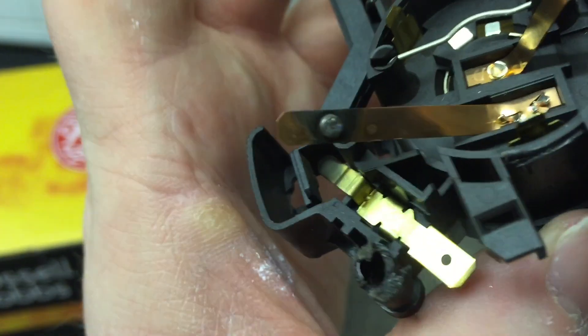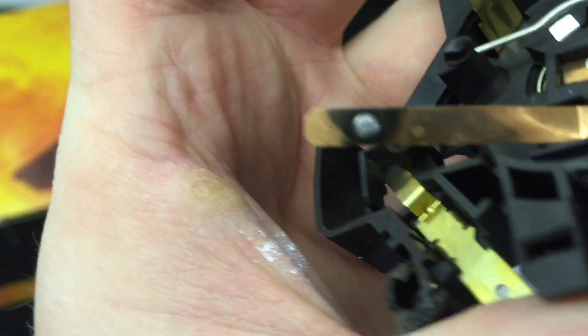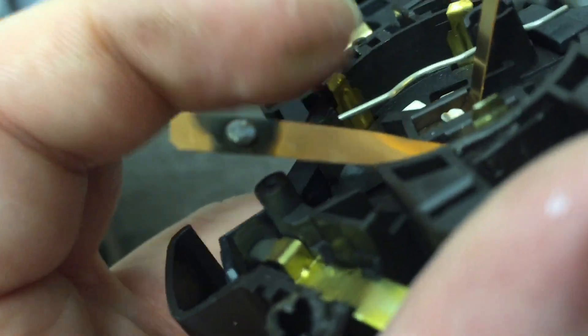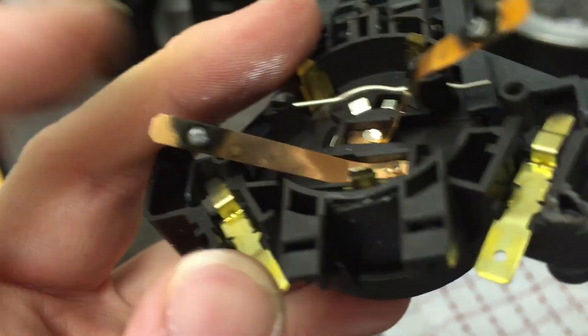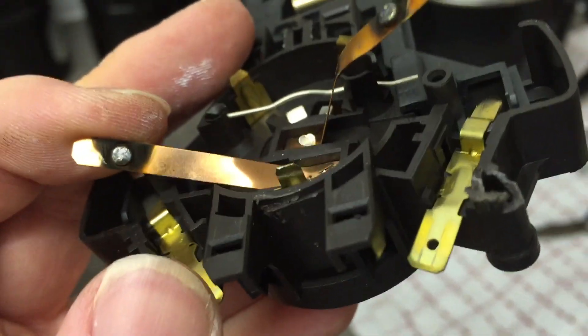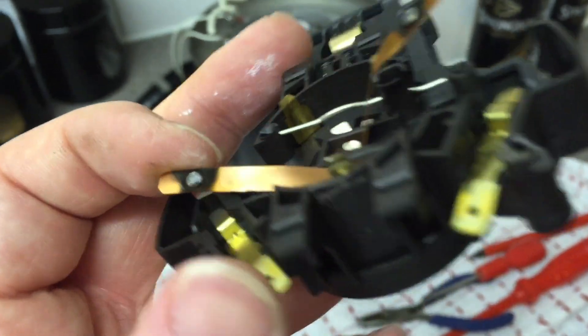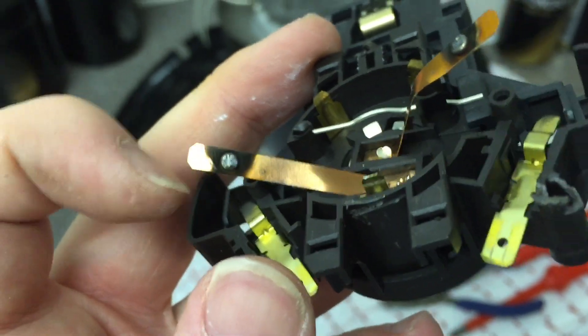So let's see if I can bend these out and see if there's any signs of arcing. You can see quite clearly here - this is the top side of the contacts that would have been making contact with these terminals which go to the element. That side's got some scorching, and this side's quite a bit worse - it's clearly gotten very hot over time and blackened the copper there. So the failure mode was that the contacts weren't breaking properly, an arc was forming. I came home and it was already like it - I could hear it very loudly - so I instantly unplugged it. Even when I flicked the switch a couple of times and plugged it back in it was still arcing, so I decided to discontinue use because anything that's arcing like that is a fire risk.